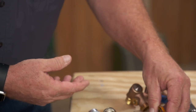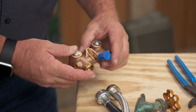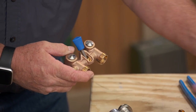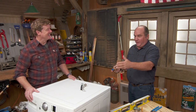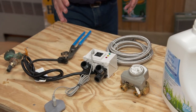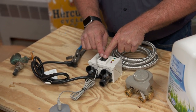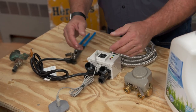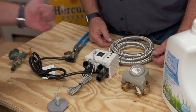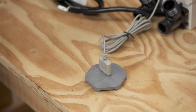An innovation was a dual-valve device where you connect the washing machine hoses, turn it on before a wash to pressurize, then turn it off afterward to depressurize the hoses. The problem is no one ever did it. Another option is an electronic device — connect the hoses, plug in the machine, and the device senses the amp draw of the washer turning on. Only then does it pressurize the hoses, and it closes the valves when the machine isn't running. It also has a floor leak sensor as an added feature.